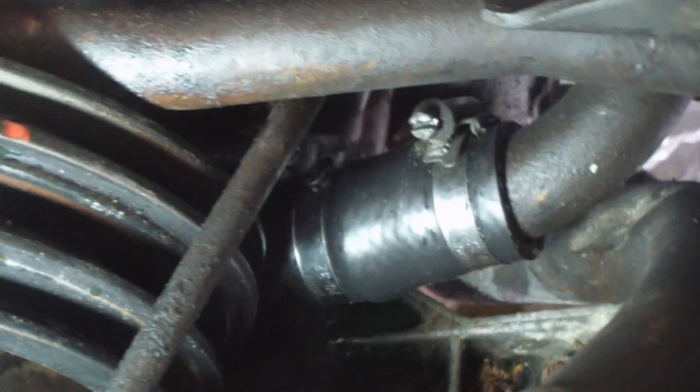Next I'm going to remove these two big hoses on the thermostat housing, and then that little tiny hose going to the head, using our reference engine. Now I'm going to take off these three nuts here. Okay, this is going to come out as one unit. All right, I've separated the two and I'm going to replace the thermostat.